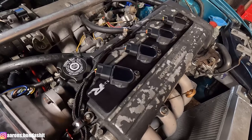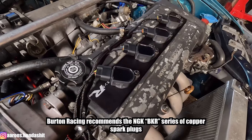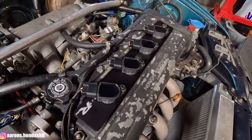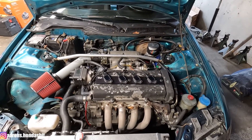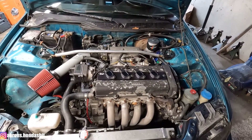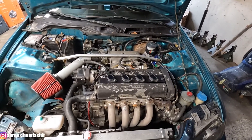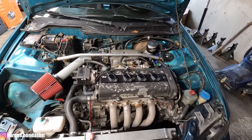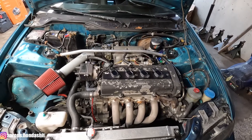I'm going to try and see if I can get this thing started up. I have some NGK iridium plugs in it — I know you need to run resistor-type plugs for coil-on-plug to work. NGK iridium plugs are resistor-type plugs, so we're good. This thing seems like it's running good. You do not have to tune the car once you put this setup in — I'm going to tune the car for other reasons, like a shitty tune done by yours truly. She's running good. I'm going to let it heat cycle and go give it a test drive.